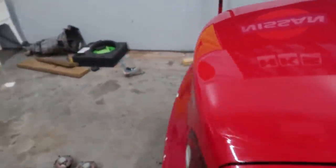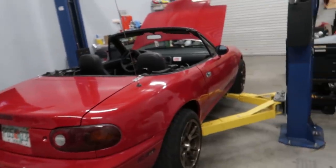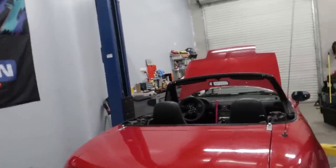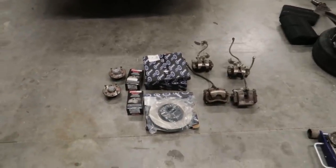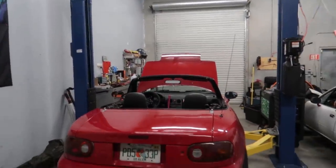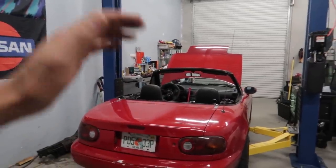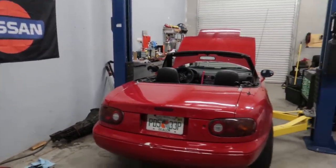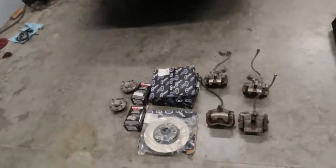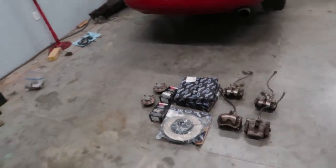The brakes are literally the sketchiest thing on this car. It's super common on these Miatas that the calipers sometimes seize up in the rear, and I'm pretty sure this one's seized open and not even working. With the power this car is making, we obviously need to look at brake upgrades — there's no point in going faster and making more power if you don't have the upgrades to stop the car quicker as well. When you're modifying a car you need to be smart. If your car already has adequate brakes for more power, great — like Skylines and things like that. But on base models like this, we need to upgrade.